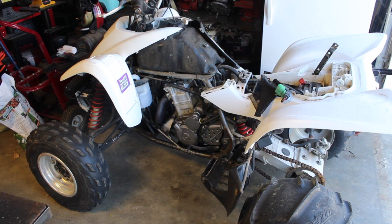Second, check to see the battery status. Third, check to see if there's ground issues. Maybe it's rusted, the connections maybe eroded or degraded or disconnected in general. So always check the ground side first. That's usually the problem. And then, you know, the positive side next. Just overall, kind of check all the connections.